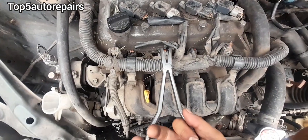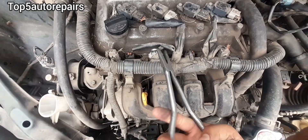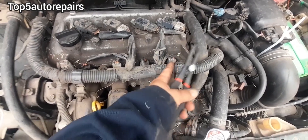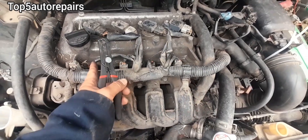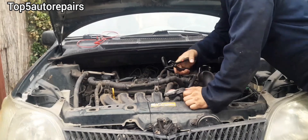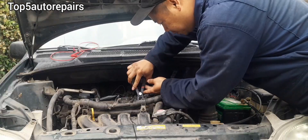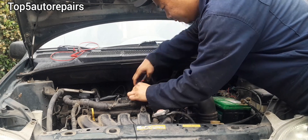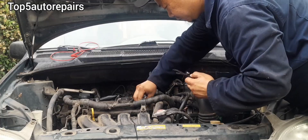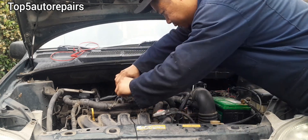This tool works just as well. Now I'm going to start the engine and we're going to start testing each fuel injector. With the engine running, when I disconnect each fuel injector, listen for a change in RPM. If you pay attention you can also hear the sound change when RPM is dropping.